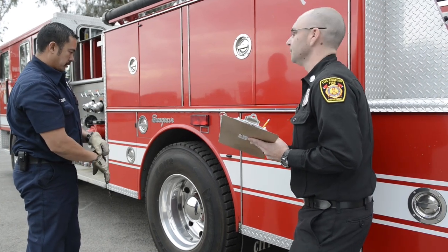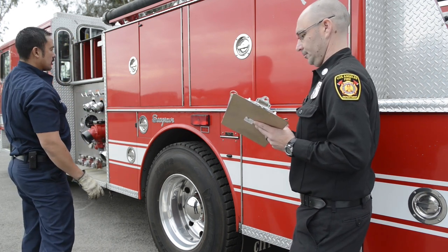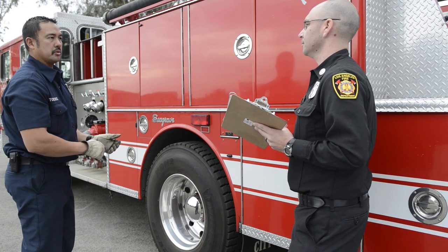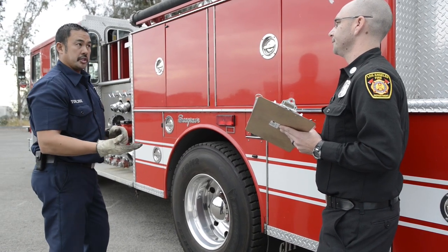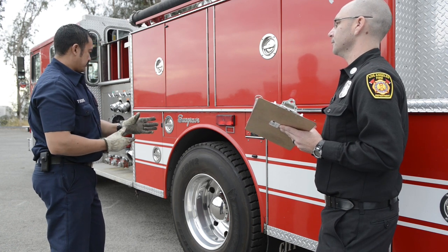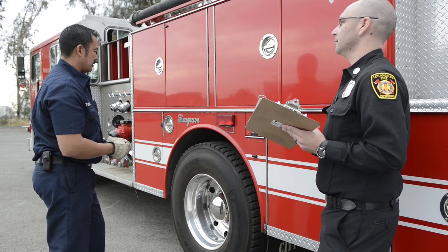There's no metal contact. And then while I'm under the carriage, I'm gonna check the whole frame along the rig, the longitudinal members and the cross members, looking for any broken bolts, welds, brackets. Also while I'm under there, I'm gonna check the exhaust. I'm gonna check all the hangers, making sure the exhaust is secure, with no leaks, either by rust or carbon soot.